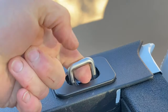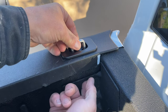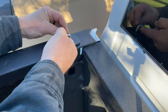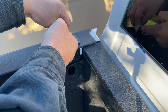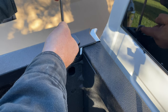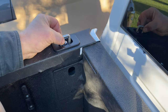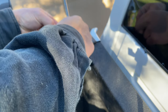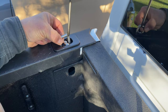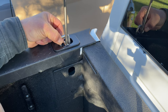Now you can see that I'm pulling up and the bed liner is pulling. So I want to make sure that my hook is on the metal. So I push that over a little bit, and then slightly pull up on the hook to make sure that it's connected to the metal, not just the plastic. Then I can put my screw and washer in and slightly tighten that down. Do the same for the other screw — put both the washer and the screw in, and snug that down a little bit.